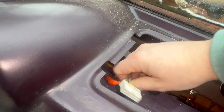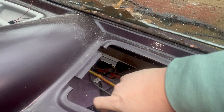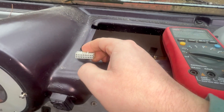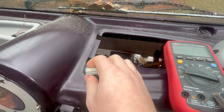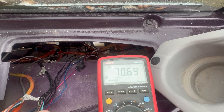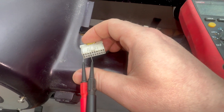The next thing to do: reach back here and unplug your connectors. This is what the high-voltage connector looks like — this is called the J7A connector. This is the J8 connector, the low-voltage one — you can tell because one's orange and one's not. On your J7A connector, the pins go from left to right, 1 through 14. We want to test that we have 72 volts on pin 1 (positive) and pin 14 (ground). It is cold outside today so you're seeing a little less than 72V on my cart right now, but that is plenty to turn the cluster on. If you're seeing 72 volts there, that's a really good sign.